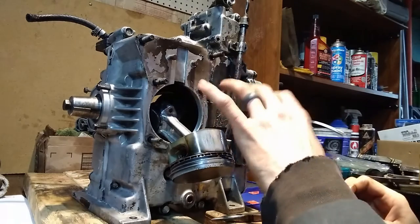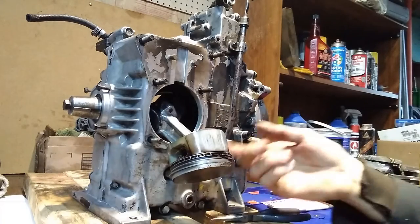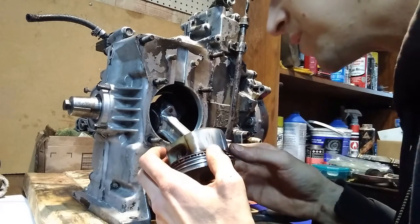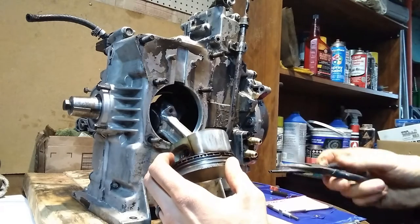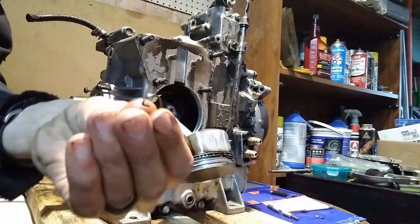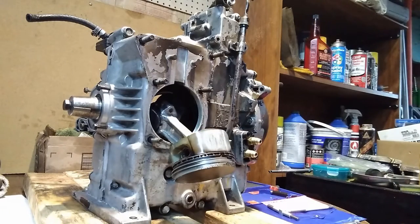When I pressure washed this engine I re-seated the cylinder heads but didn't torque them down enough. On one of the bores, a little water had seeped in while I was pressure washing from all directions, coming at the gasket from every angle. That caused a little bit of rust in the cylinder bore — not terrible, it'll hone out fine — but again, cleanliness matters. I removed the snap rings from both sides to get the piston pin out. One snap ring flew across the room — luckily the new pistons come with new pins.